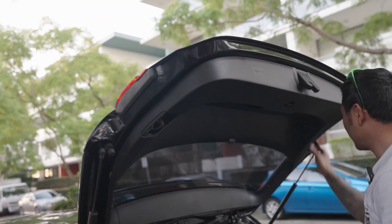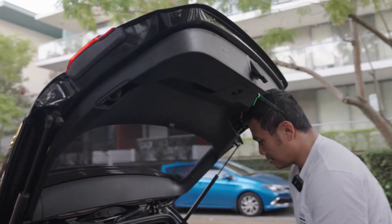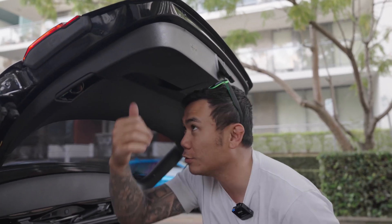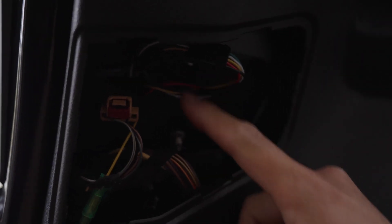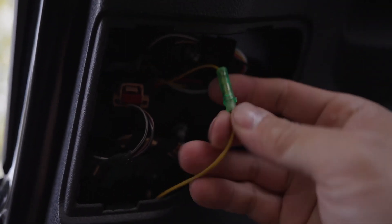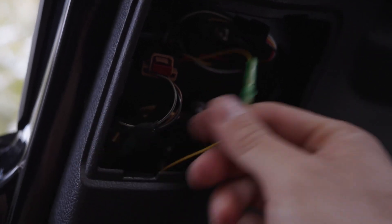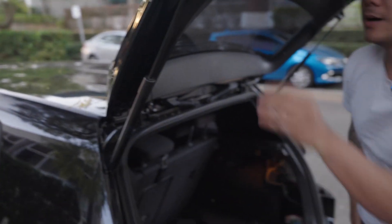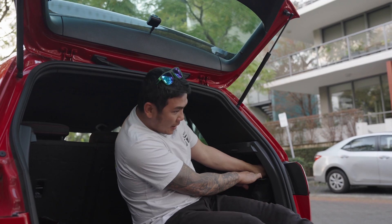Here are the new parts — that's for this side and that's for the other side. You need an 8mm, two bolts, and then there's the yellow cable that links up to the other tail light for the blinker. You've got to run that down through here — it takes a bit of time but we'll get there. It's getting dark.